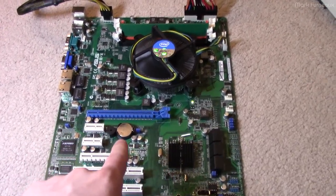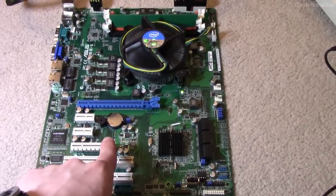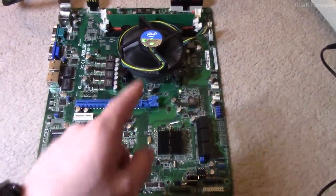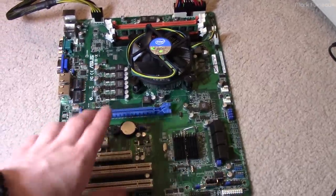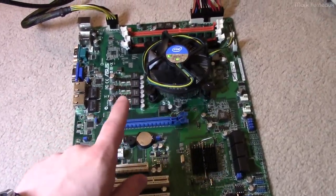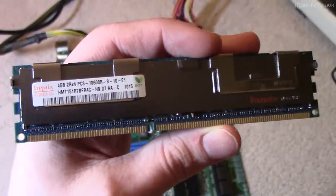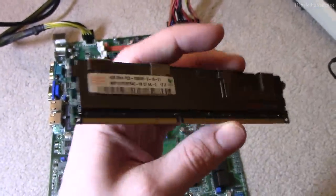Okay, that was different — that was four short beeps, and it's not repeating. Let me reset the board. Yeah, four short beeps — that's different. After quite a bit of troubleshooting, I think I figured out what's going on. This board only supports ECC as far as I can tell, and the memory I was using — some SK Hynix ECC — is registered memory, because most server ECC memory is registered, which takes some load off the memory controller. But this board is weird: it does not use registered memory. It only uses unregistered ECC memory.